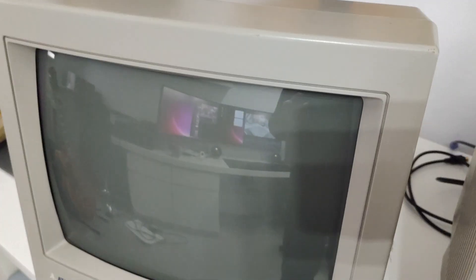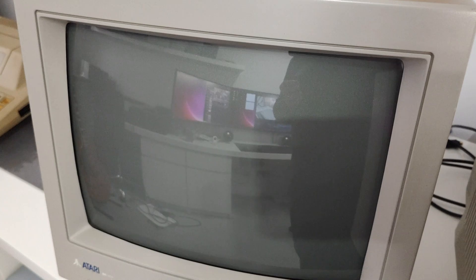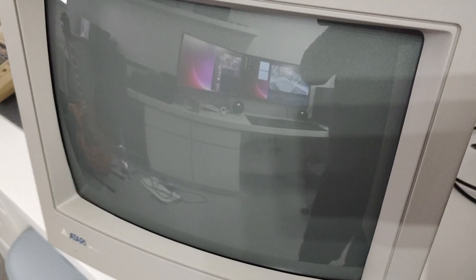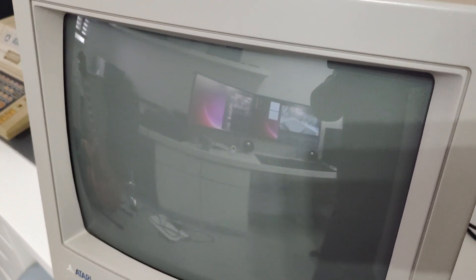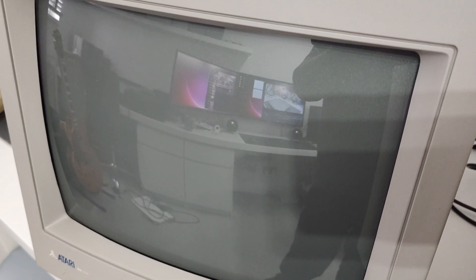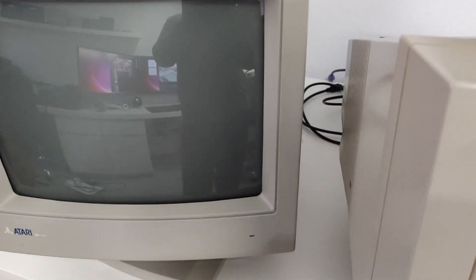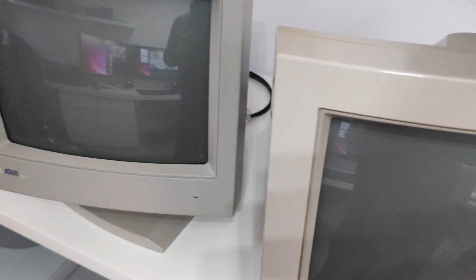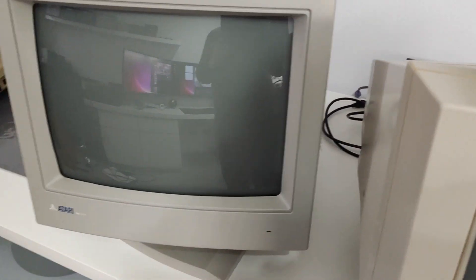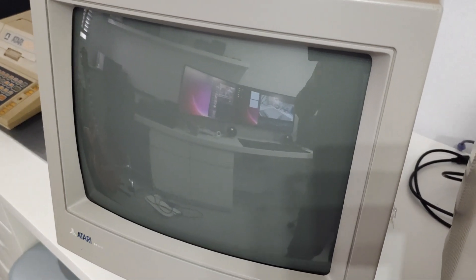Now, I believe somebody did it — there's a post I can't find on the Atari Age forum. I can't remember offhand if somebody actually just did a motherboard swap. I'm inclined to think they put a Commodore 1084S motherboard in one of these monitor cases, because that'll work as well — the later versions of the Commodore 1084, the 1084S, were also based on the innards of this Philips monitor. So that's three different families of monitors that all basically have the same insides. You can swap and change parts, although obviously you'd have to drill holes in the back of the Atari monitor for the extra inputs and switches.